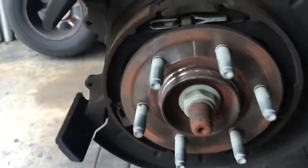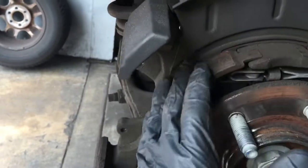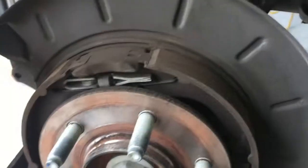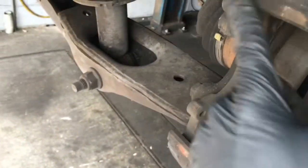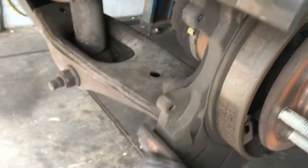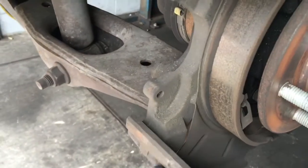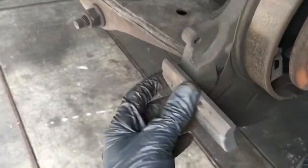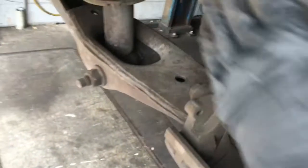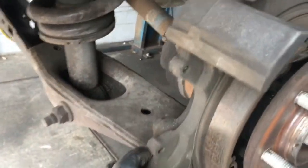While the brake rotors are turning, I'm going to do a little prep work. I'm going to inspect my park brake shoes to make sure they weren't left on and burned, and make sure they're in good shape — which they are. Then I'm going to check these little slides right here where the brake pads ride. Use a little wire brush and clean these up, and make sure there's no large divots. If there are, you may lightly file them. If they're too bad, you may have to replace the bracket.